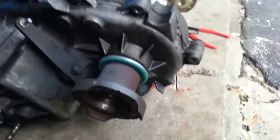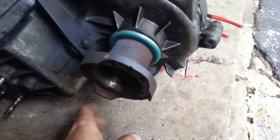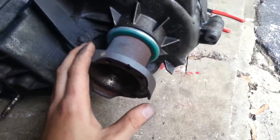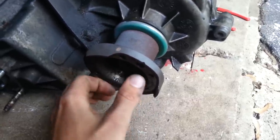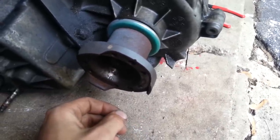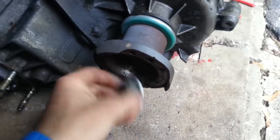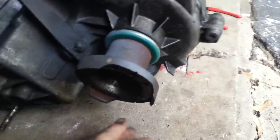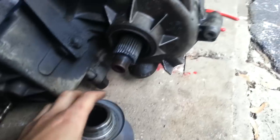One other thing I forgot to mention: if you have a double cardan front drive shaft in your Jeep before you do the swap, and you get a transfer case that has a different front output shaft, they can be swapped out easily. Just one nut on the front, this comes off, and you can swap out the shafts. I'll show you — that way you can reuse your front drive shaft. Because no matter what, even if you have the donor shaft, you can't use it because it's obviously too long. So you have to use your front drive shaft, which is what I did.